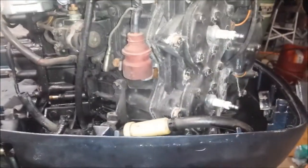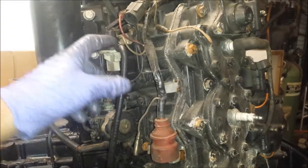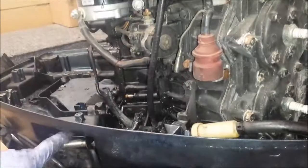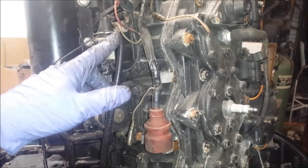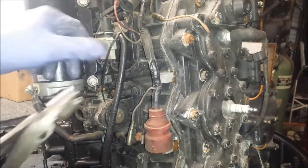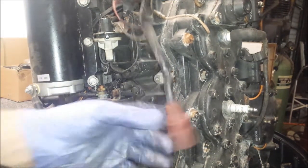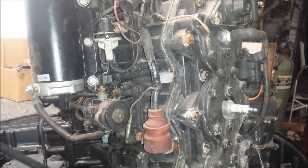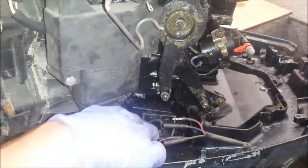Now, get everything else apart. We have a fuel line here. Runs up to whatever this thing does. So it connects to the motor and the fuel connector there. Runs through here, comes back, loops up there. This used to connect to the VRO pump, which is already gone. So all I got to do is take it off from up here. One option is just cut it. But my pliers are easier to find than my dykes. Excuse me, diagonal wire cutters. So, let's take it off there. And we just look for anything else that might be attached. Not really looking like it. Nope, I don't see anything.